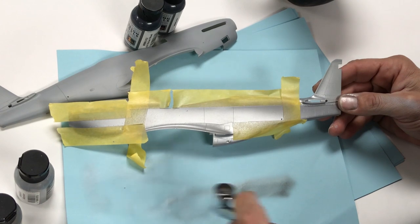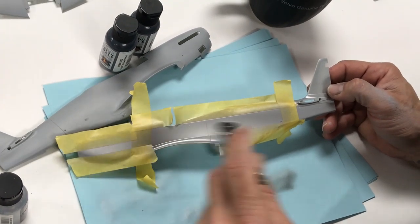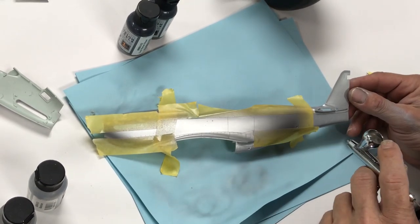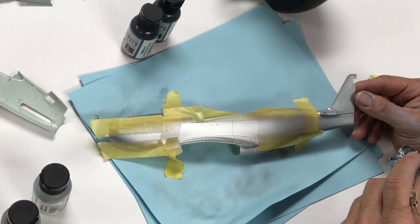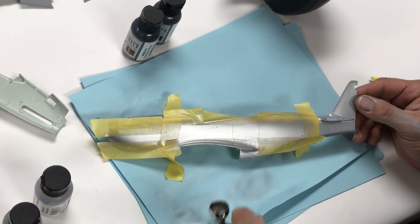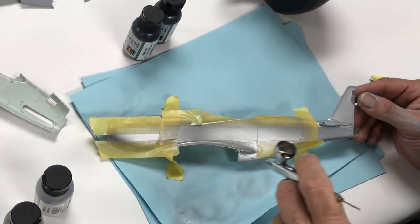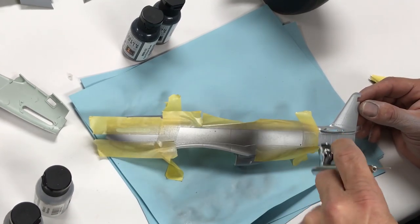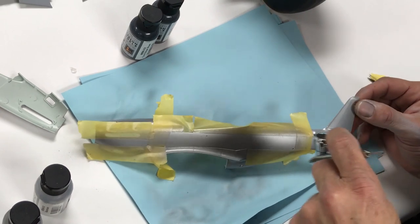We've let this dry and now we'll do a few more passes — light wet coats; you just don't want to flood it on. One thing to mention: at the beginning of the video we did a little dry sanding with a 2500-grit pad on the primer. The smoother your base coat is, the more refined and smoother your metallic shades will be. It's optional depending on how much work you want to put in. You can progress through different grits — 2500, 3600, all the way up to 12,000 — to get a mirror finish out of the primer before doing your metallics.